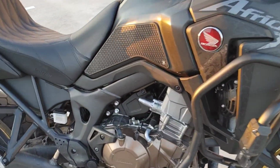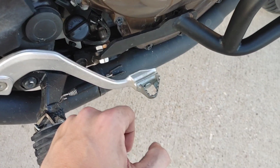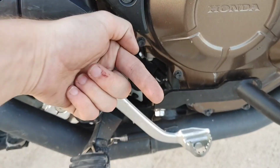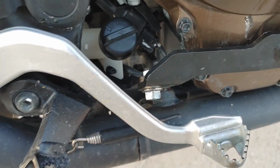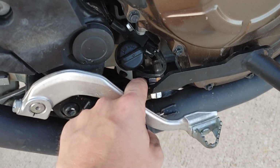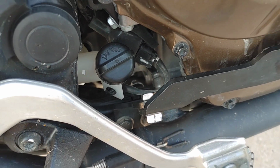In particular, this one piece down here, this bracket where it connects into the frame with those two bolts. In the instructions they give you two bolts for that, and they want you to put those bolts in coming this way. However, as you can see, due to the space in there, that's impossible. The only way that these bolts come out is coming this way. Also, this bracket simply slides over the factory bolts, it is not like holes through that bracket, and they clamp down on it.